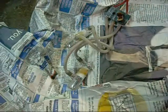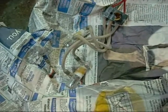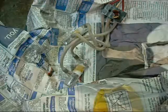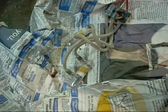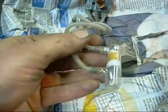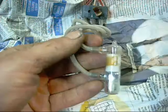One thing that caught me off guard yesterday was a wall-mounted hot water dispenser for coffee cups — basically the kind of thing you find in a cafeteria. It's a very old unit with copper tanks and everything in it, and I was about to start ripping it apart with a 9-inch grinder when I realized there are a couple of these mercury tilt switches inside it, for controlling heating and flow of water in the tanks. There's an upper and lower tank in these units.